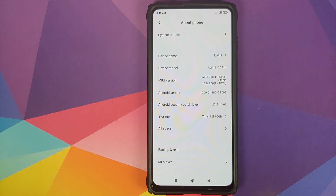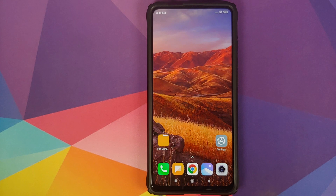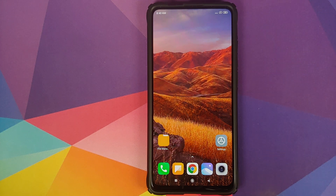As you can see I have the Redmi K20 Pro running MIUI 11 Global Stable version 11.0.3.0 based on Android 10. The prerequisites for this video are that you need to have an unlocked bootloader and TWRP recovery installed — I have separate videos for both linked in the description. Make sure your battery is charged at least 50 to 60 percent; do not do this if your battery is at 20 or 30 percent. Also make sure you have a backup of all your pictures, videos, and anything important, because if you run into any encryption issues or boot loops you will have to do a format data from TWRP recovery, in which case you will lose everything on your device.